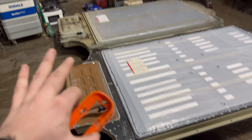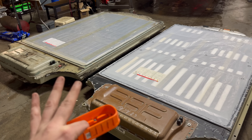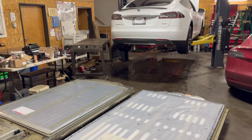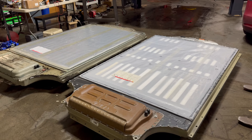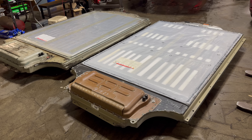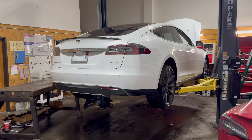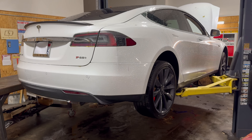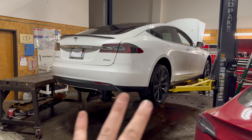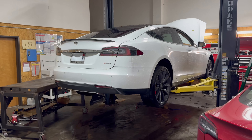There's really not a huge weight difference between the two packs. The weight difference between this pack and the old one is less than 200 pounds — near as makes no real difference in terms of the capability of the car. It's basically about one extra passenger's worth of weight. This car is equipped with air suspension, so no adjustments are required — the air suspension can compensate for the weight, no problem. If it were coil suspension, we would probably want to think about replacing the struts. On my personal car, I didn't end up swapping out struts and it's perfectly fine.